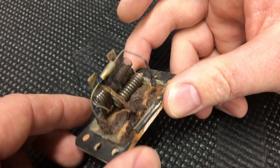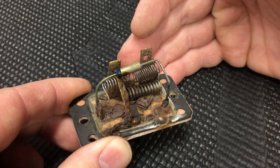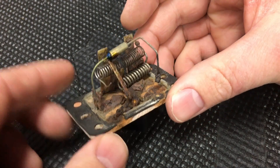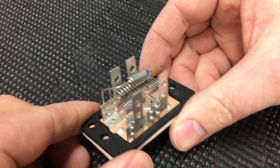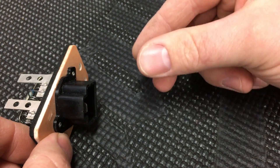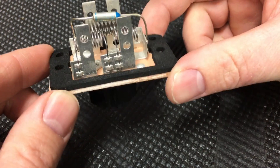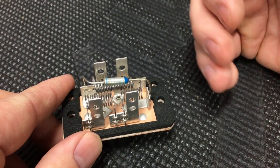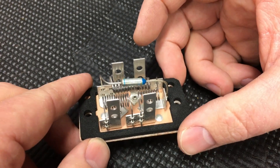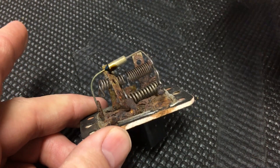One last very important tip: if you find out that your blower motor resistor has failed — either it looks like the corroded example or you've gone through the diagnostic steps and confirmed it truly has failed — you don't want to plug in your new one from the parts store and let it dangle on the floor in excitement to test the different speeds, because your excitement is going to be short-lived. These are designed to be bolted into the HVAC case with all that blower motor air passing over them to keep the coils cool. They can fail within 10 to 15 seconds if they're not in that airflow stream.